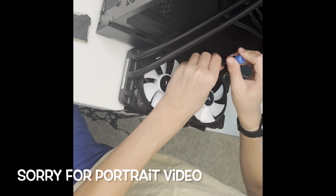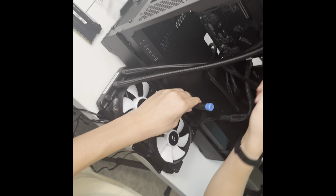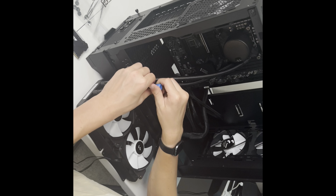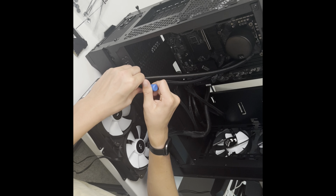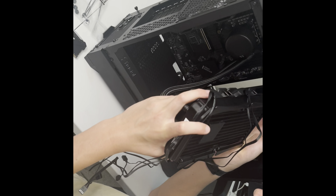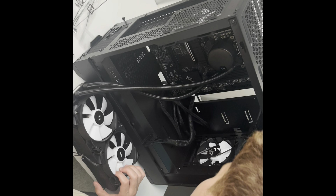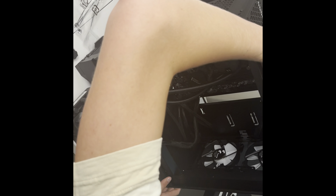What's happening right now is we tried to put the radiator in and it didn't clear the RAM, and then the radiator got stuck up there. So what we did is take one of the fans off the radiator, take the RAM out, and now we're going to remount the AIO up there. Once we screw in the AIO, we're going to try to put the RAM back in — if that works, great; if not, we'll have to front-mount it.